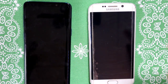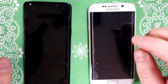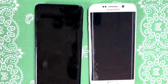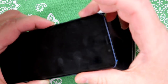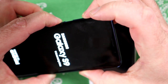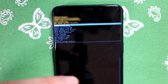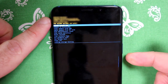First thing we're going to do is make sure our phones are charged, then we're going to go into recovery mode. Your phone doesn't have to be rooted and you don't have to install any software — this simply works as it is. Phone is off. Hold the power button, the Bixby button, and the volume up button all at the same time until you see the screen. To navigate, you cannot use the touch screen — you're going to use the volume up and volume down buttons, and the power button acts as the enter button.